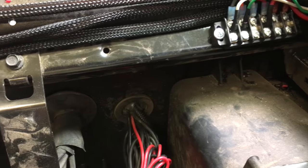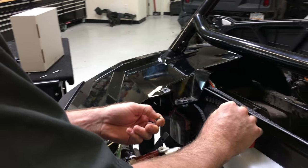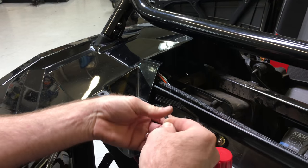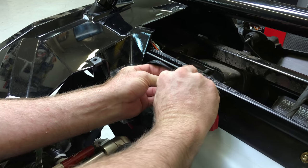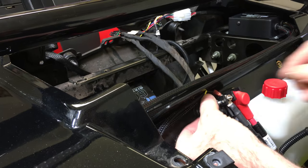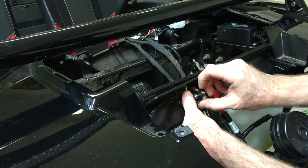It's kind of hard to see with the camera here, but there's a little bit of light. So we added those extra wires which run right to our accessories through the cage. Now there's two feeds right here — one's black, one's yellow. Those will light up your lower LEDs on the rocker switches. Black needs to get hooked to ground; yellow is your accessory wire — power when the key's on — which is going to light the lower LEDs on the switches when the key's on. The upper LED will light up when the switch is engaged and the circuit's live.